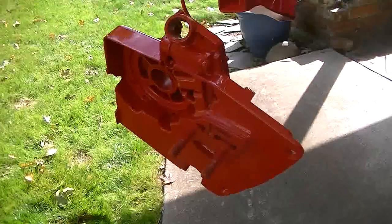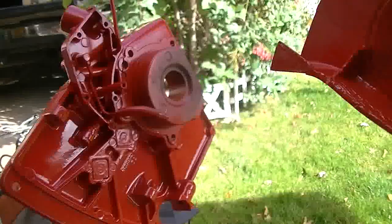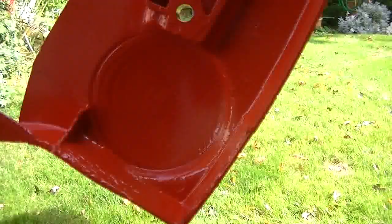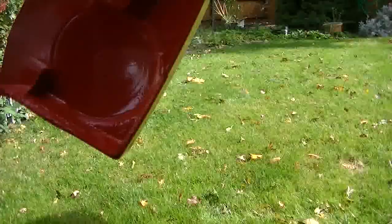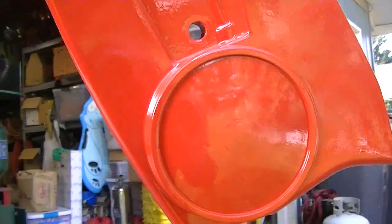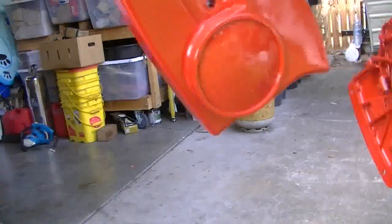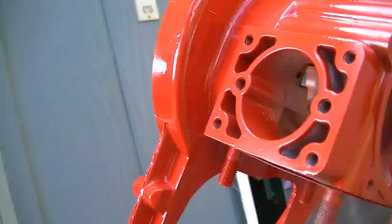I think the drive case is coming out okay. There are places where you're not going to have the smoothest paint flow, but most of them end up being hidden. That's why I like to spend my time on stuff that really matters. This drive case cover had a hole rubbed in it from the clutch nut, like so many of them do, so I used some JB Weld as an epoxy to fill that up. It's not perfect, and I could have spent more time on it, but it's good enough, especially when the fresh decals go on. It will blend in quite nicely. I didn't go crazy trying to paint the areas that are internal to the engine — you really don't want the paint in there. The gas will dissolve it, so those will all end up getting cleaned out.